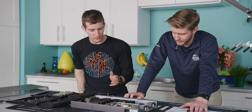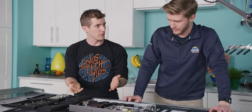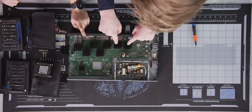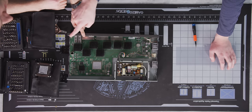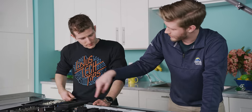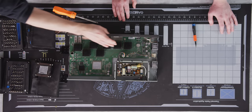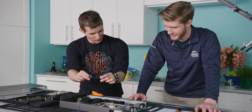This is not as expensive as a RED camera, but this is still an $800 network switch or something like that — let's be careful with it. I almost wonder if we could just get away with putting little copper things on here and then running a heat pipe straight across all of them. If we used a ball nose bit that was the right size, we could cut a channel right in the top the right size for the heat pipe, and then just solder it on — spreading the heat out toward our cooling.